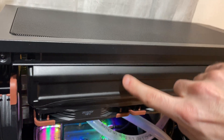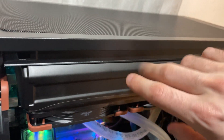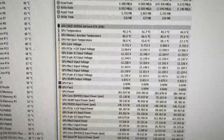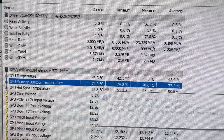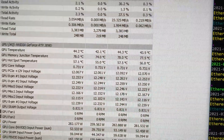You'd be fine with 1500 RPM fans with a 60mm radiator — 1500 RPM is enough to saturate a 60mm radiator. Just for kicks, let's crank it to 3000 RPM. Nine minutes in: mother of god, it has not made a difference at all — maybe one degree. So anything past about 1700 RPM is a waste of time.